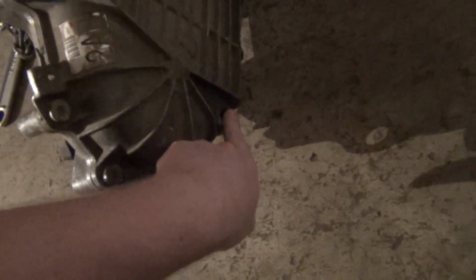Okay. Well, anyways, that's interesting. Where the hell do you fill it up at? So anyways, we'll have to hunt down that. And then, I bet you because it's at an angle, that's the fill plug, and you only fill it up a certain amount, just enough for the chain to drag and the oil pump to lift it up.